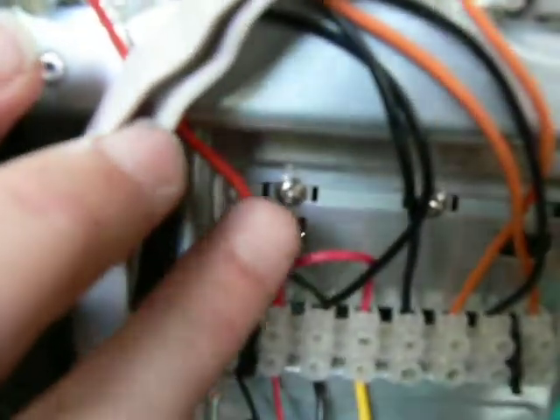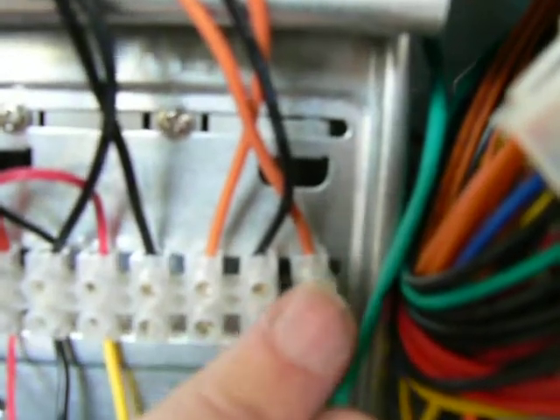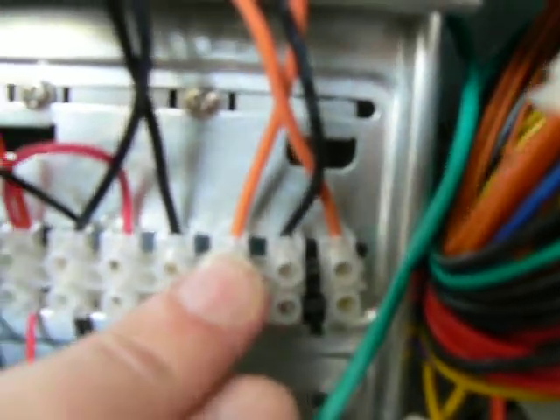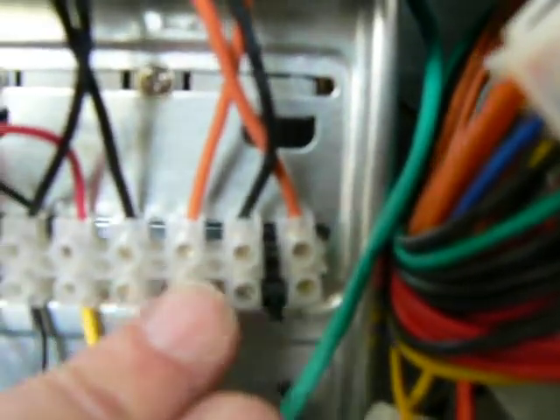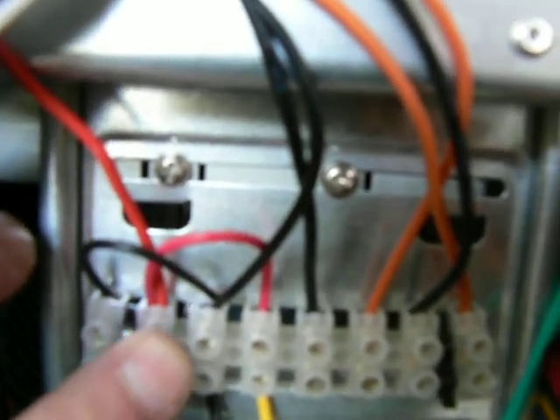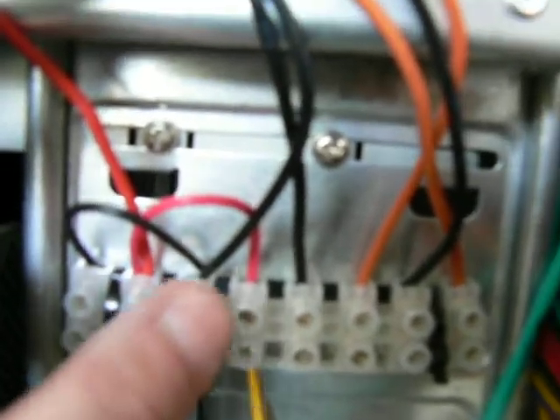This is the main reason for running the terminal block — it's going to power the fans and the LEDs. We're using the orange 3.3 volt wires to power the purple LEDs, and the red 5 volt wire to power the fans. At the top, the power coming into the terminal block gives us 3.3V then an earth, 3.3V then an earth, twinning the supplies. We only had one 5 volt wire, so I've jumped that across to get two 5 volt outputs, and jumped the earth across as well.